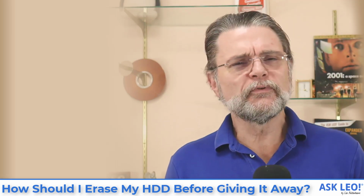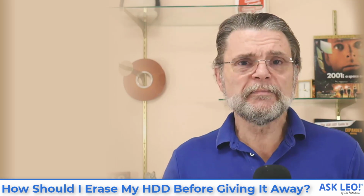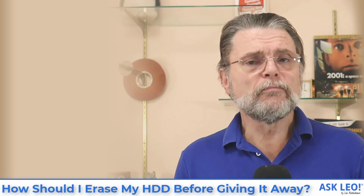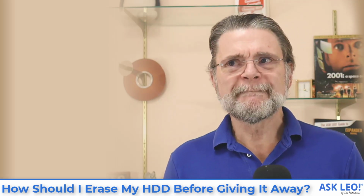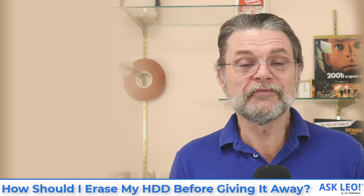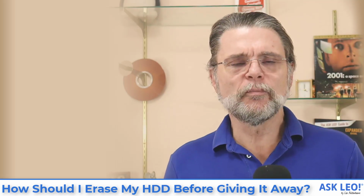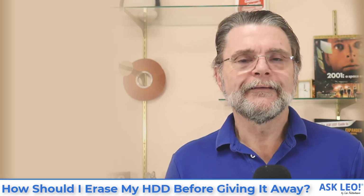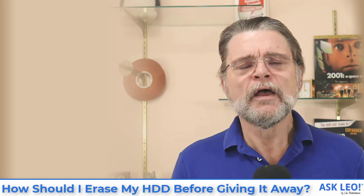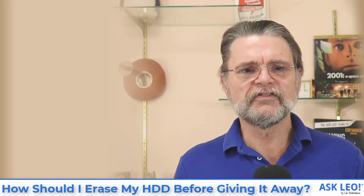DBAN is the tool we've been pointing people at for a very, very long time, simply because it's a good general purpose tool. It will do multiple passes for government officials, because there seem to be some requirements around that, but for the paranoid as well. For you and I, in most cases, a single pass is fine, but if you want more, go for 3, go for 5, heck, go for 35 if you've got the time. But the bottom line is, for most cases, a single pass erase is just fine.